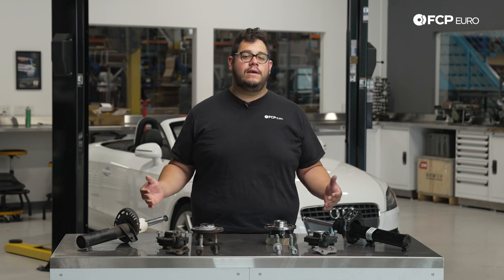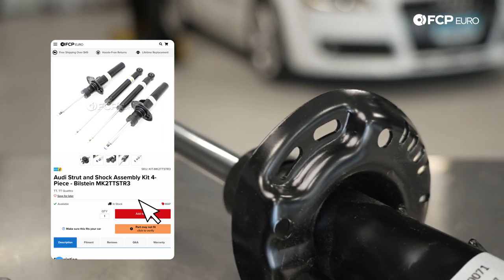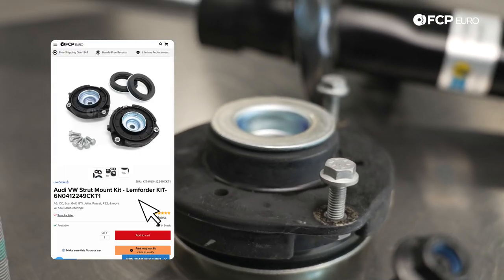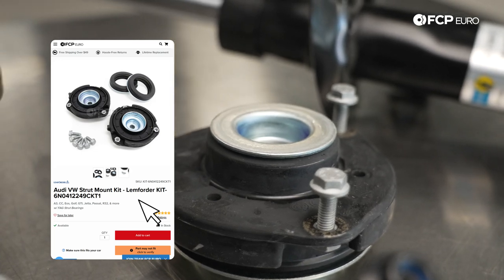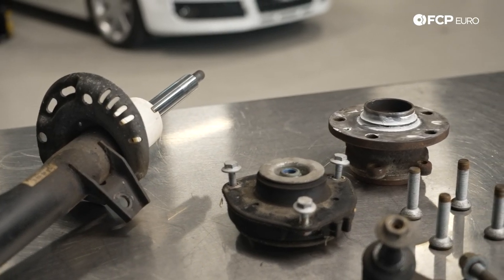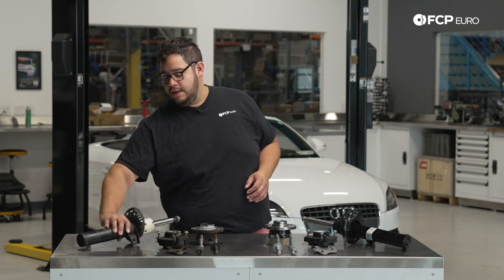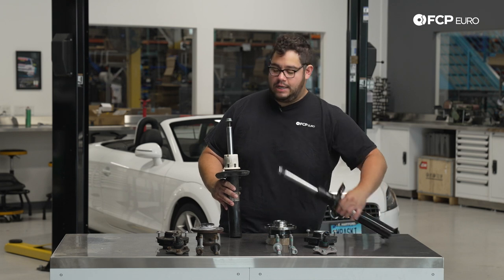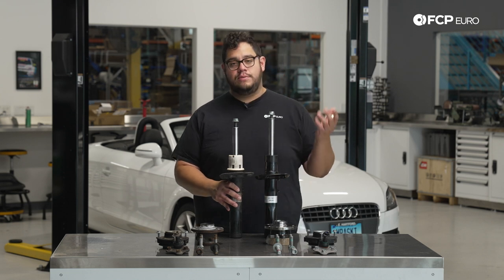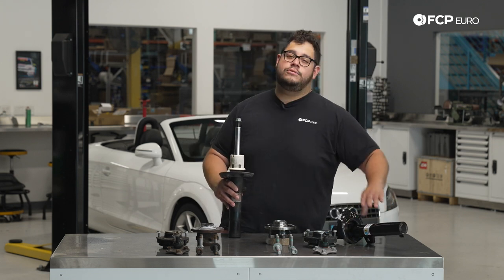As these units start to fail you're going to get a bumpy ride up front — sometimes it'll get a little springy as they wear out and the car tends to ride on the springs more than anything as the compression goes. The strut mounts can also fail — the rubber starts to degrade. That's what happened to this car at 122,000 miles; the strut mounts failed so every time you hit a bump it was a nice clunk. We can tell the shaft on the old strut won't even sit as high as the new Bilstein unit — it has lost most of its compression, which is pretty standard. They typically last 60 to 100K depending on driving conditions.